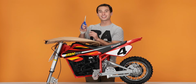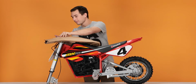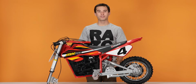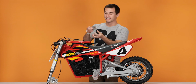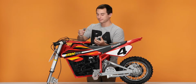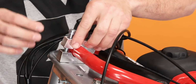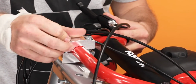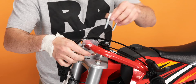Take your scissors and cut the tape securing the cardboard. Remove the cardboard and get rid of it. In your provided bag of assembly hardware, take out your 2 brackets with the bolts. You're going to want to separate them, put one bracket on the bottom and slide the other one down on top. Slide the bolts through the holes in the bottom brackets and then thread them into the frame. Now do the same with the other side.